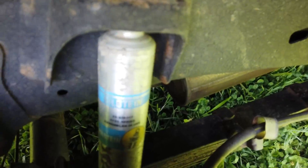The 5100s are in the front, and then I have the Bilstein 5125 in the rear for the shocks — you can see them there, the 5125 series. Along with those I have new All Pro expedition leaf springs, which I found used but in good condition. They were only on the previous guy's truck for about 7,000 miles because he needed something heavier duty for his projects. His truck was absolutely gorgeous — fully custom, sitting really high, probably with about four inches of lift.